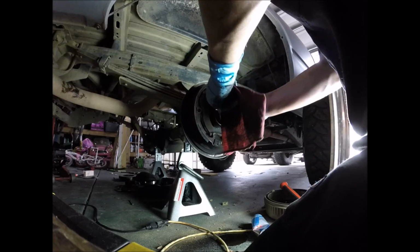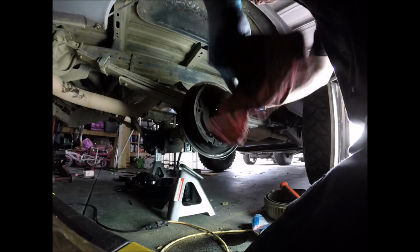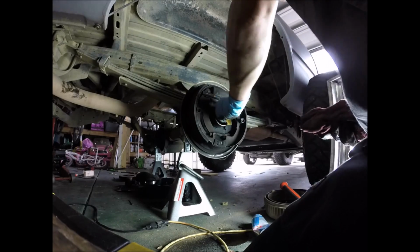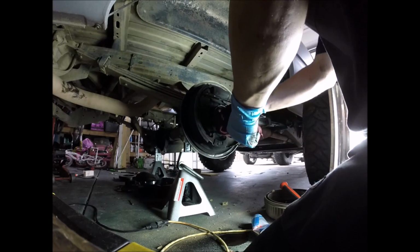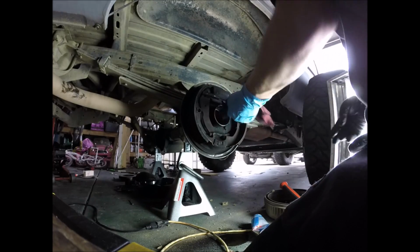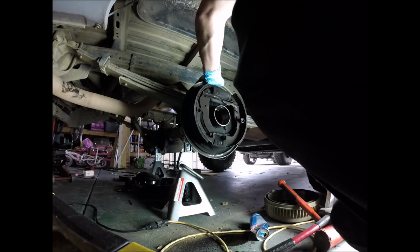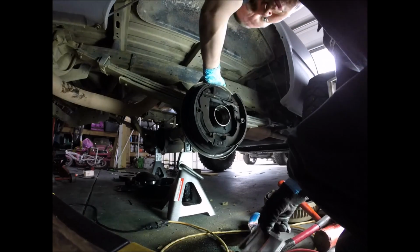Same thing, we're gonna just sand down the inside. Not sand down, but just run around it, make sure that there's no burrs in anything or anywhere. Okay, that's it. You don't want to sand a lot. You don't want to oblong the hole. This is a bad situation to oblong the hole. Oh, the axle fell over.